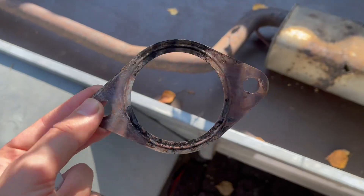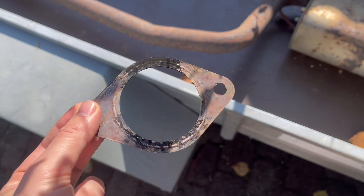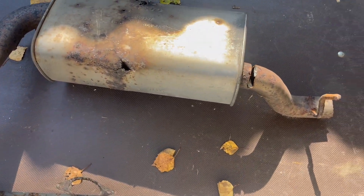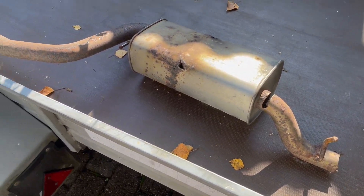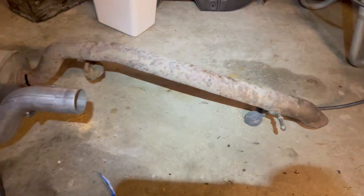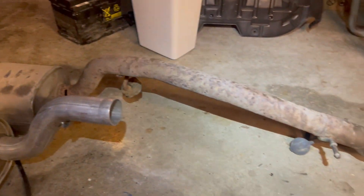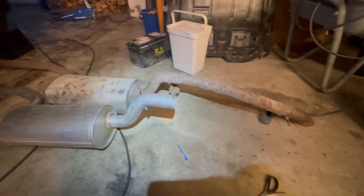This pipe is just so long, and because of how they have routed it, getting it out of the car is somewhat hard. I actually needed to slice into the exhaust — you can see it on the right side — for it to bend a little bit, to be able to angle the exhaust downwards and get it all out. If you are on a lift I guess this won't be a problem, but even on these blocks it still gave me trouble, so I had to cut it up a little bit and bend it.